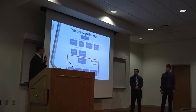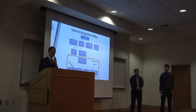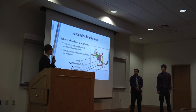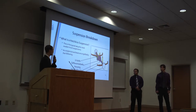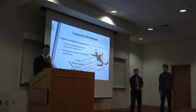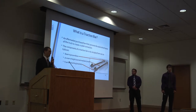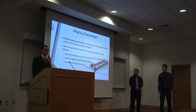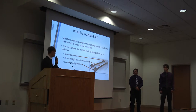In order to talk about our traction bars, we first need to discuss the suspension of the vehicle. This is a Hotchkiss suspension, typical for most modern trucks today. It is typified by the U-bolts shown in green, the differential axle housing shown in purple, the shock absorbers shown in yellow, the leaf springs shown in red, and the wheel hubs shown in white. The traction bar is an aftermarket part that connects the axle to the frame to add rigidity. It has bearings at the top, a main straight or bent shaft, and frame mounting brackets at the bottom.